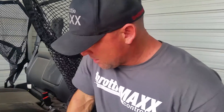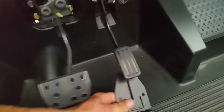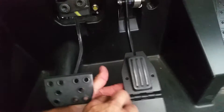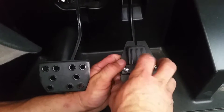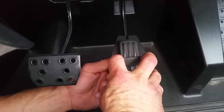If you want to come on in here, I'll show you how to mount this thing. You want to take your ThrottleMax pedal and slide it right up under the factory pedal so that it fits in the notches and brackets provided. Take your hardware with the bolts attached and slide it up over there, then hold it in place while you get your nuts started by hand.